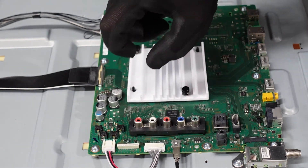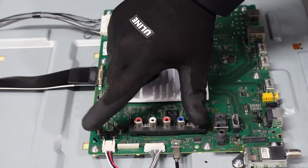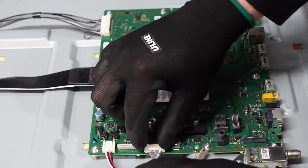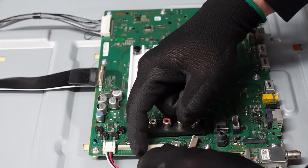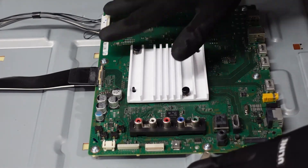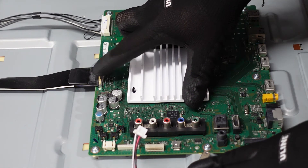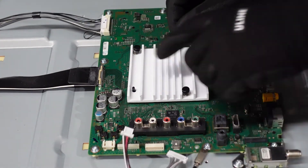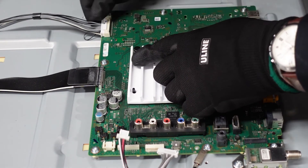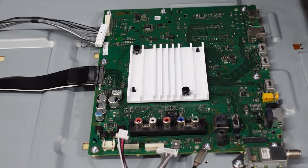This connector here you're going to pinch on the sides and pull out — it has two releases that are very small, so you'll probably need to use two hands. This one here we're just going to pinch and pull it out that direction. For the next connector, use both hands to get enough pressure and that slides right out. This is your LVDS — this particular setup has a plastic piece right through here. Press down in the middle to release and pull that ribbon out on the other side. Then pinch at the top to release that flap and pull the last one right on out. Now we have everything disconnected and we can move on to the screws all the way around it.